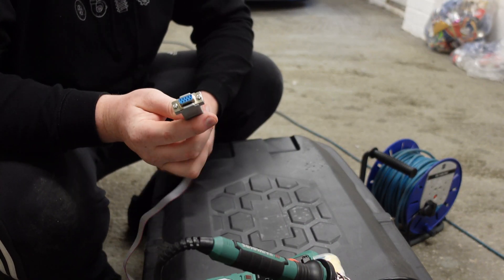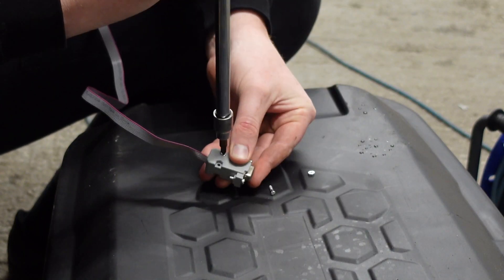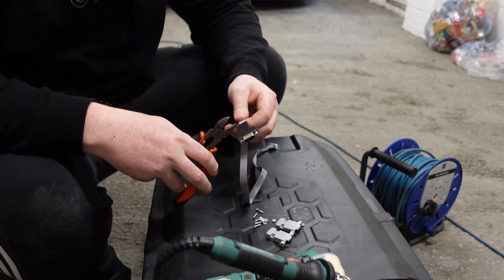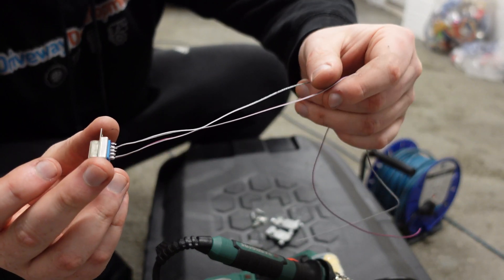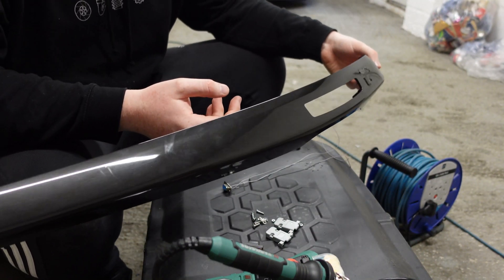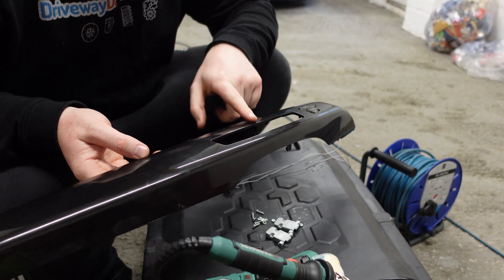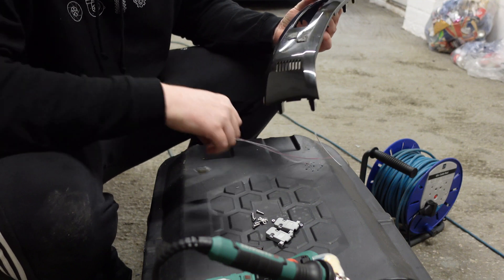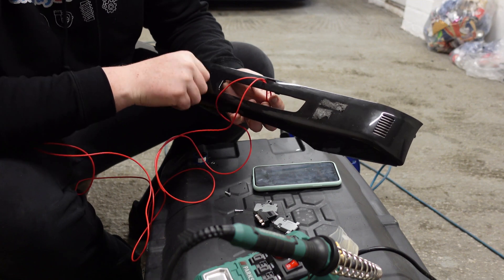We only need to use two pins on this connector — a ground and a five volt — so I'm going to dismantle it and cut this end off because we don't need it. I've now desoldered it all, so we've just got the five volt and the ground. Because it's a track car I don't want to be digging around looking for the cable, so I'm going to fit a port right here. These are the same parts as the Lancers, so if it ever becomes a classic car it can be reversed.